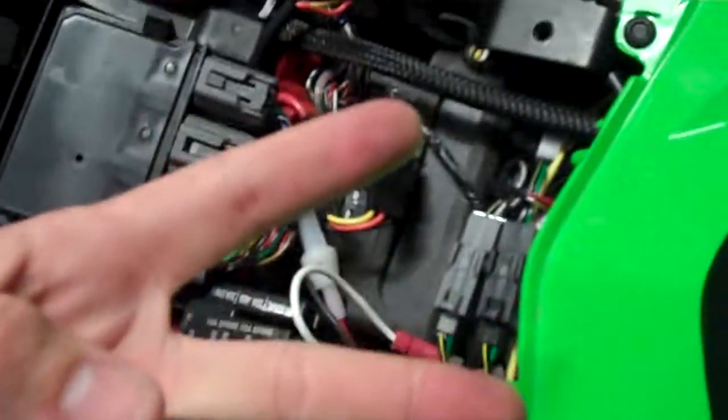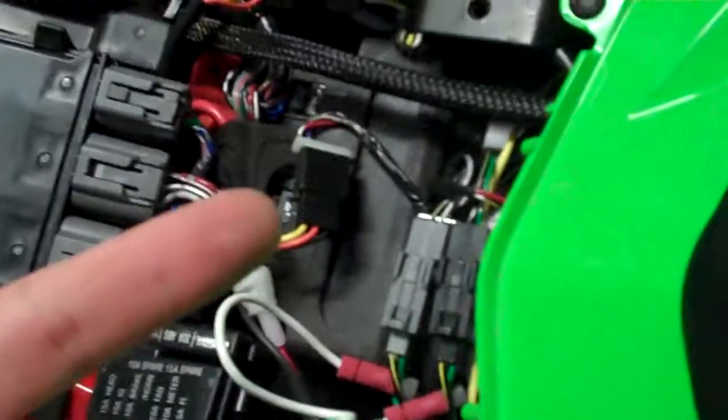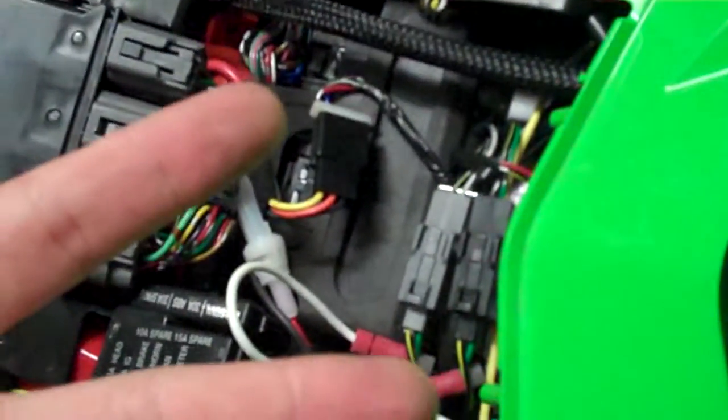The yellow wire goes back to the switch — it comes in here. There's two diodes in here. This end is joined, this end they are separated. Join two white wires to them. So inside it actually looks like this: imagine these are the diodes and they split at one end — joined at one end and split at the other. So the white cable connects onto them and splits, connecting up to these little green wires for the indicators in the back of the bike.